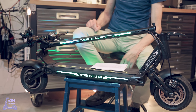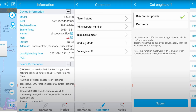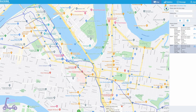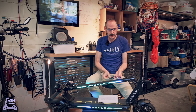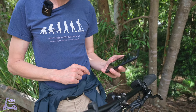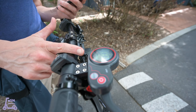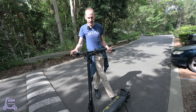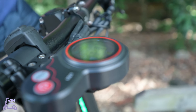There is an optional GPS tracker available which will show the location of the scooter. It sends vibration alerts to your mobile phone if someone tampers with or moves it, and it also has an immobiliser built in. The harness is exactly the same as the Carbo Series scooters — it interconnects with a relay to immobilise the scooter and fits inside discreetly. To demonstrate: sending an SMS command to it causes the lights to go off and an error to be thrown on the screen — Error 10 — so it's totally immobilised. To restore operation, just send a command back, the error is cleared, the lights come back on, and you can drive away.